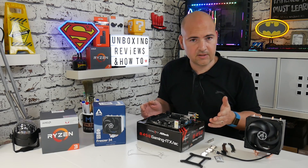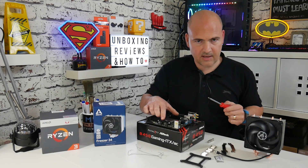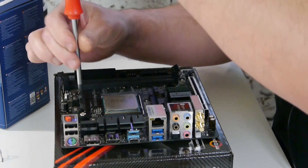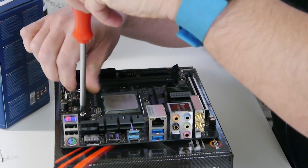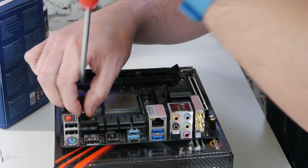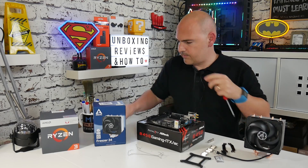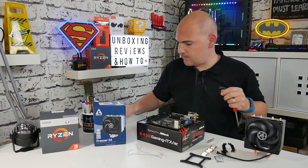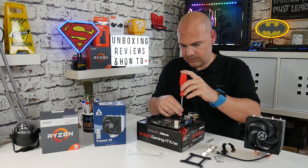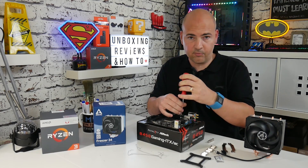The first thing you need to do is remove the two plastic retaining clips from the standard AMD backplate. There are four screws holding them on, so just unscrew and remove the plastic. The backplate beneath you need to keep — I'd suggest putting the old bits in a bag or in your motherboard box, in case you change the cooler later or need to RMA it.